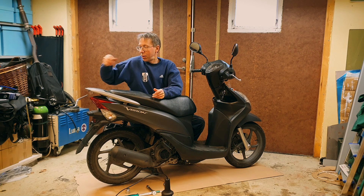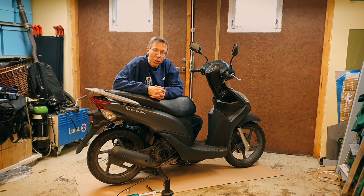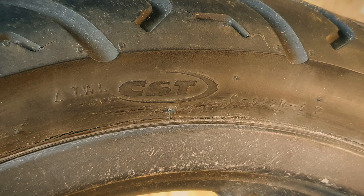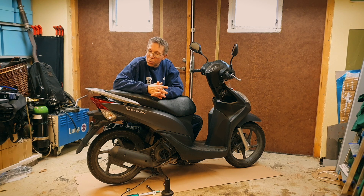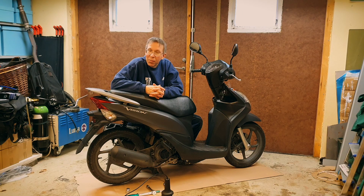It has a date code on it saying 10 14, and as far as I understand that means it was made in the 10th week of 2014. So right now the tire is just about nine years old. If it would have been a Michelin or some high-quality tire I don't think it would be an issue, but it's a CST tire — probably a Chinese brand — so the rubber quality is a bit so-so and it's starting to crack. This little red wear indicator is also now flush with the rest of the tire.